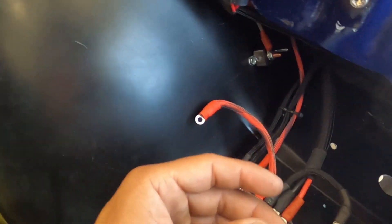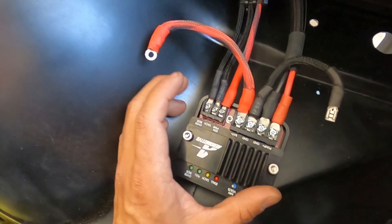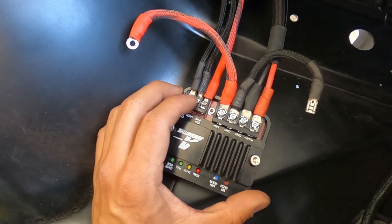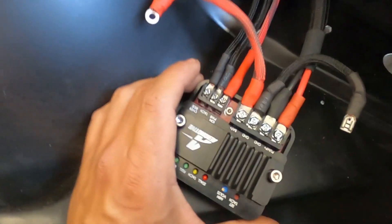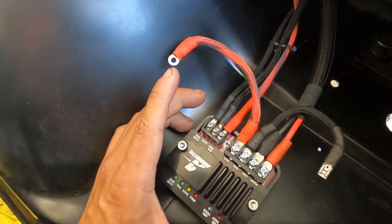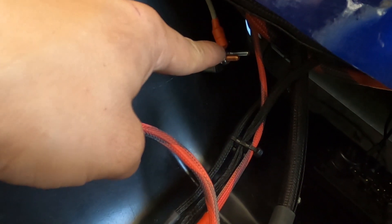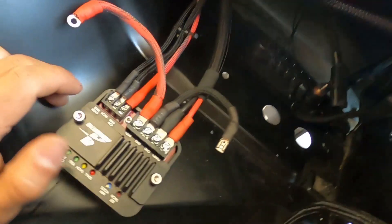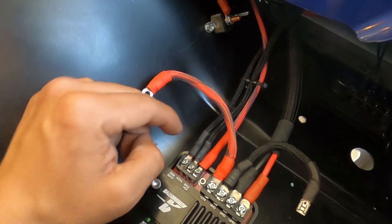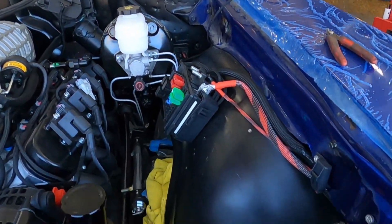It was a pain to film in that little fender corner — not ideal — so I went ahead and pre-ran everything and hooked it all up. One heads-up: Aeromotive's little connectors on the side don't fit well. I had to find alternatives and almost had to cut the ends off to get them to fit. But we have everything pretty much ready to go — battery output going back to the breaker, fuel pump wire coming in, and the ground looping back to our grounding post.